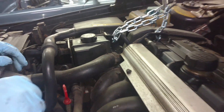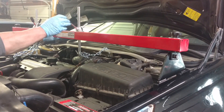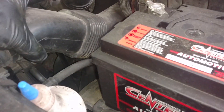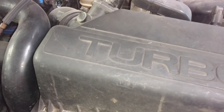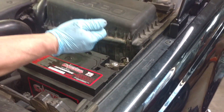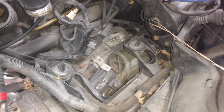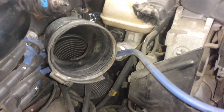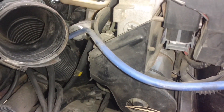We're going to take a little slack out before we start lowering the subframe. So we're going to remove the air tube, then remove the battery, unplug the mass airflow sensor, take that clamp loose and remove the air box. I got my upper intercooler turbo pipe loose going through the throttle body, then took the turbo hose loose going down to the bottom of the intercooler. Now I'm going to take this turbo tube off so it'll be out of my way when taking those bolts out of the transmission.